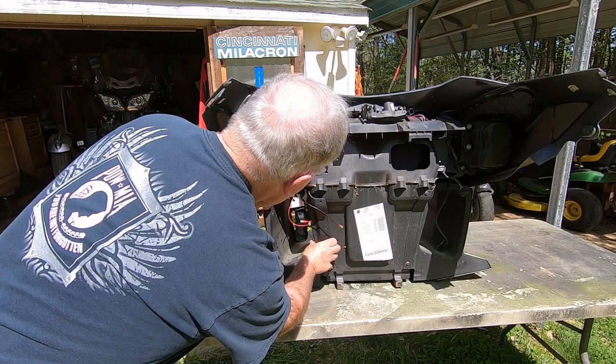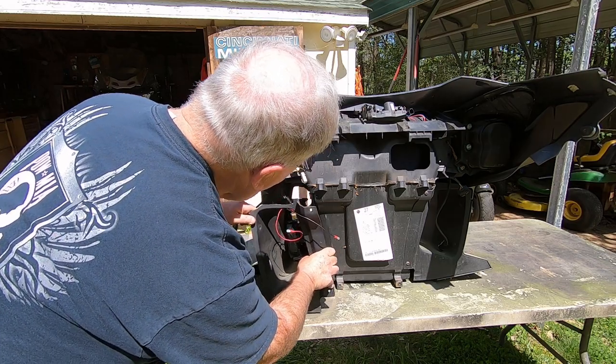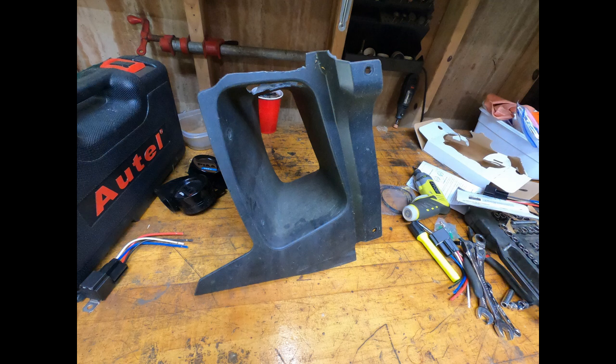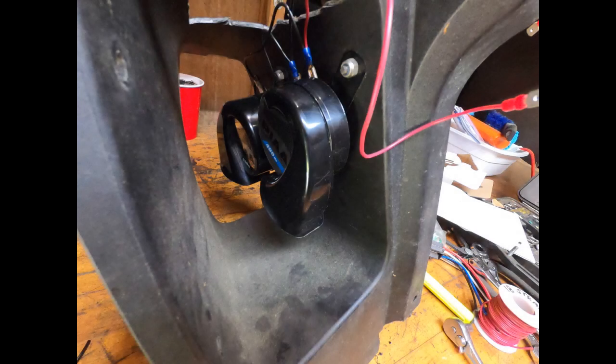The horn location is going to vary from model year to model year. My 2011 RTS had the original horn in the frunk module on the left side. What I decided to do with the new horns was put them in a very similar area in the air tunnel on the left side. The first thing I had to do was take off the front trunk module, which is not covered in this video. I then had to remove the left side air tunnel — the tunnel removal is easy, there are two screws and four pushpins. Mount the horns in the air tunnel as close to the rear as possible. Don't worry about that large hole I cut out in the top of the air tunnel — it was just another brilliant idea I had that didn't work.